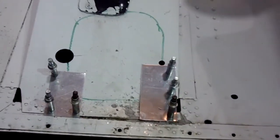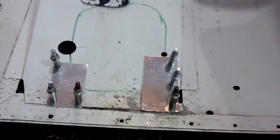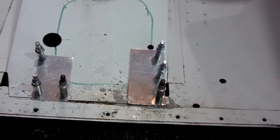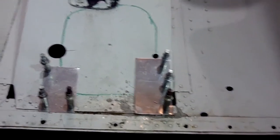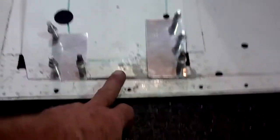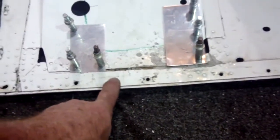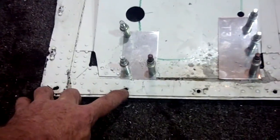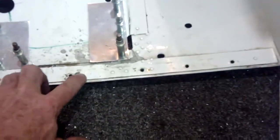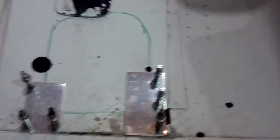In the passenger air exit ramp we've got our two doublers in place, drilled and clicoed. Now we're ready to cut out where the Power Flow will exit the new cowling, then cut the cowling so that the back section becomes a removable piece with a line straight down each side. We're also going to add another fastener here — two screws holding this part of the cowling, three on this side, plus one more so this piece won't wobble around. We're having a lot of fun with this.